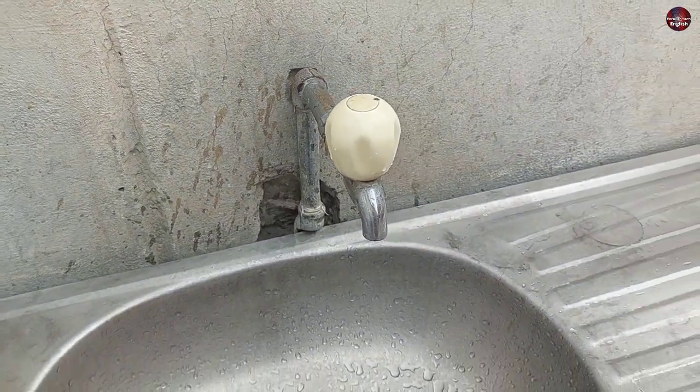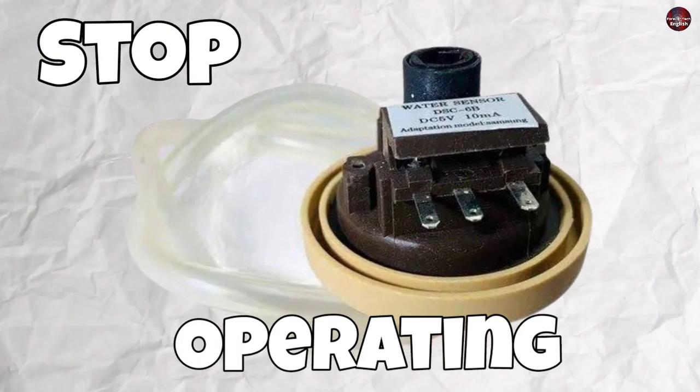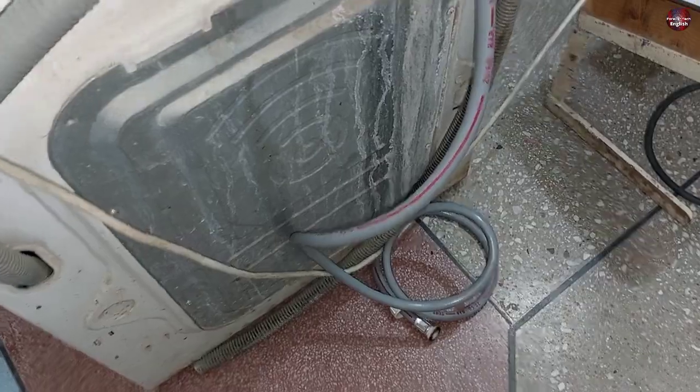The pressure should be good enough that the washer fills the drum in under four minutes, then the water level sensor will stop operating and the washing machine will not show an error — as long as the pressure is good and the water is flowing towards the machine.